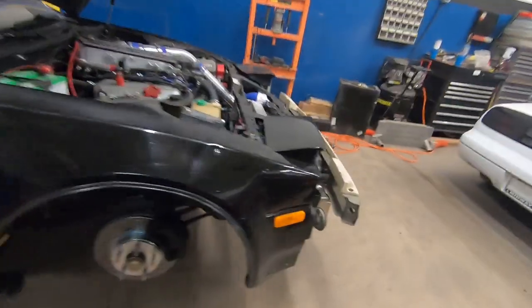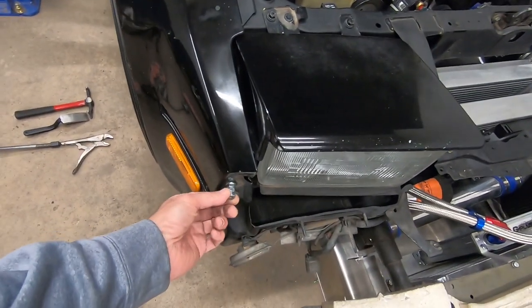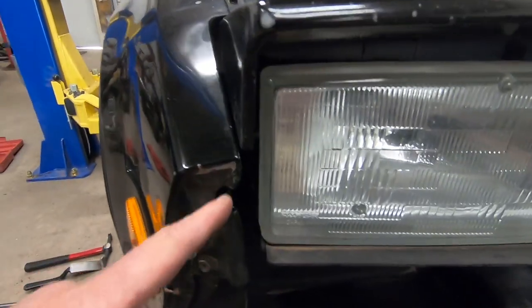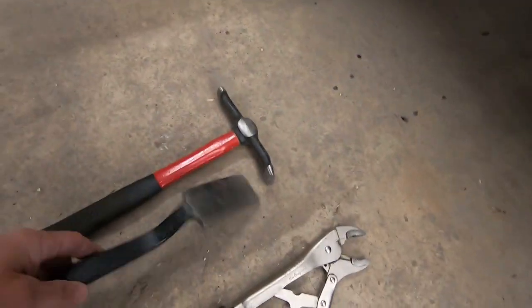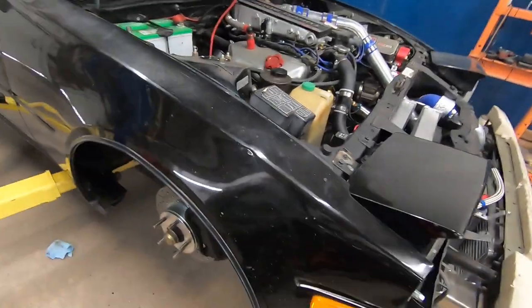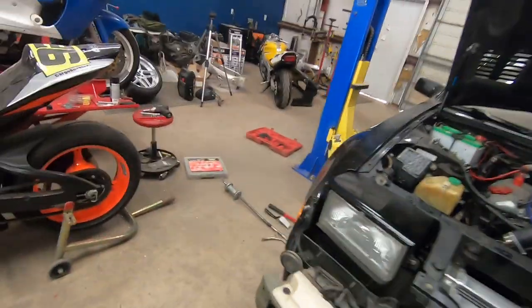We're gonna get back to this project here — the Z31 turbo. We've got to pull the fender out a little bit. I came up with an idea: I put a bolt through the back side and then put some nuts on the end. I have a sliding hammer with an adapter for a vice grip — I'm gonna lock it on there, use some different angles when I pull it, and see if I can get this to straighten out a little bit. This is what it's supposed to look like right here. I also have a body hammer and a flat piece to put on the back side to get some of these pronounced things out and bring the shape back.